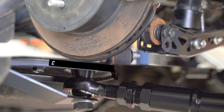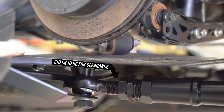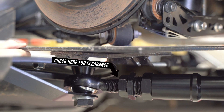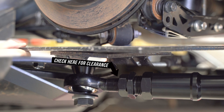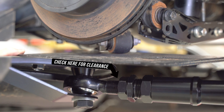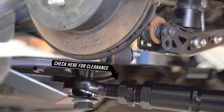Pro tip number 368: depending on how low your car is and where the locking nuts end up when tightened, there may be some interference — so keep that in mind. Lift your wheel up on full compression and down on full droop, and check for any nasty contact. If you get some, you may need to trim the OEM bracket. In our case, we cleared and we are good to go.